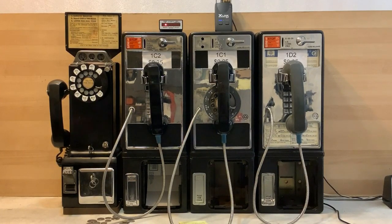Now I'll move on to the dial tone first single slots. What's interesting about the 1C1 and 1C2 single slots is they could be built as either dial tone first or coin first, and they could also be switched back and forth by moving jumpers in the phone. The Bell System's way of changing a dial tone first 1C2 to a coin first 1C2, although not difficult, is tedious and time consuming — you have to completely dismantle the payphone and make more than 35 wiring changes. What is unique about my fifth generation controller is you don't have to do any of this; if you want to coin first a 1C1 or 1C2, the controller does it for you.